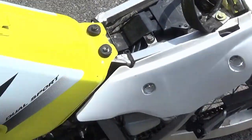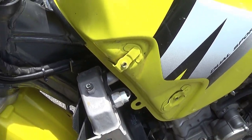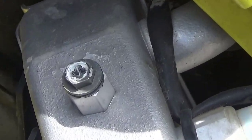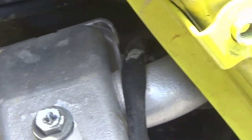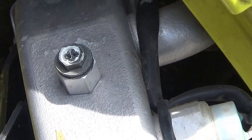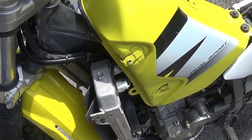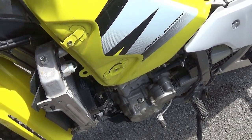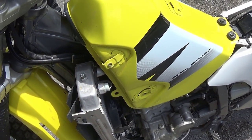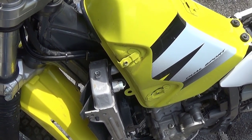The other thing you have to do, since this is a split system, is there's an air bleed screw right here on the top of this radiator. Even if this isn't the same bike you're working on, if you've got a split radiator system or a long radiator, look for an air bleed screw to make sure you can bleed the air out. Sometimes you may have to crack the sensor loose to get the air out, because any kind of air in it — sounds crazy — but any kind of air will cause it to overheat.